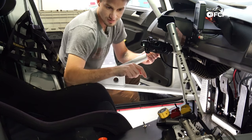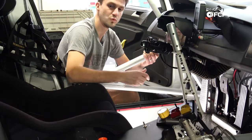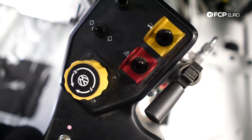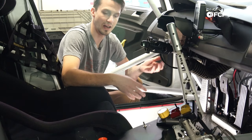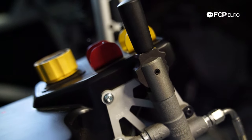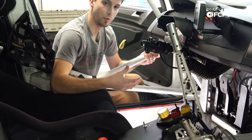The other bias adjustment, along with the balance bar knob, is this proportioning valve. The proportioning valve is a really quick way to adjust the maximum brake pressure to the rear brakes. One issue with these front-wheel-drive race cars is it takes a lot of time to get temperature into the rear tires because they don't do a lot. So we'll start the race with a more forward bias. As the rear tires gain temperature and therefore more grip, we can knock this down one, two, or three spots to get more braking performance — it cuts off the peak pressure to the rear.